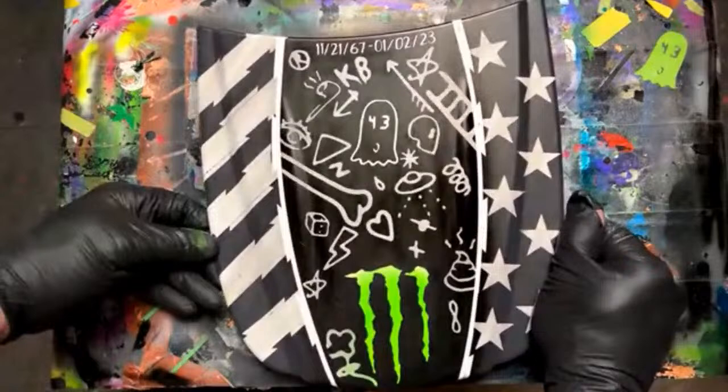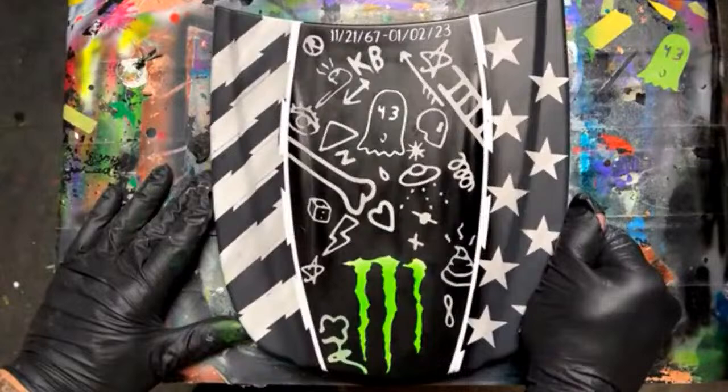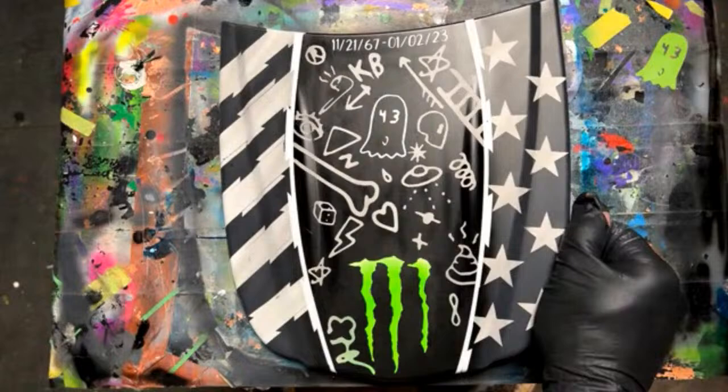But if you want to use U-Pol, which I think you can get for like $80, $85 for a quart, you can use that as the mid clear sessions, and that's fine too. I say that because I've done it for years. Some people say, why would you mix products? Well, you're really not supposed to if you're mixing them when they're wet. You wouldn't mix a hardener of one company with the clear coat of another. That's just not going to work. It's not the same stuff. But if it's drying and it's sanding, I've never had an issue with that.